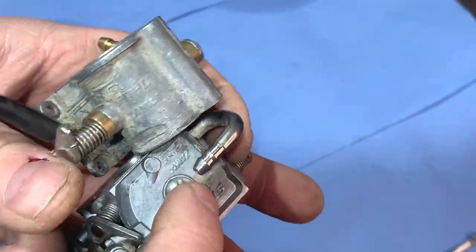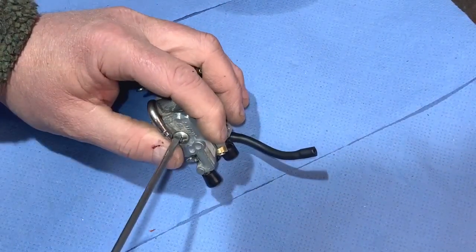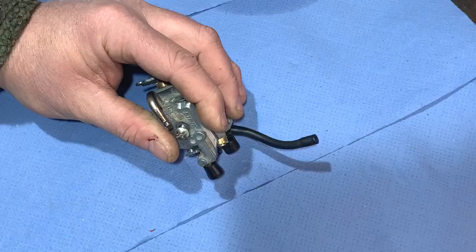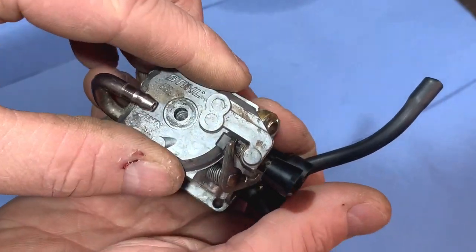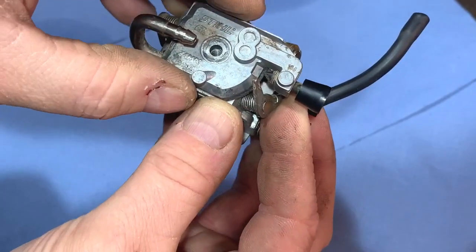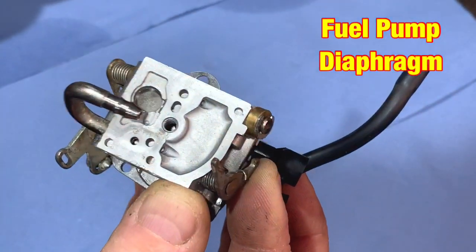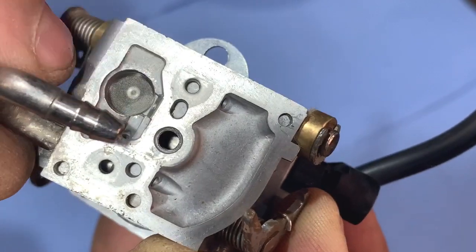I'll take these out as well, but firstly I'm going to take that side off. I'll put that around there and unscrew this. I had took this side off before because I wanted to check everything was right in the kit I bought. Just hold that throttle piece over a little bit to get that off. In there goes a gasket and then that screen piece — there's not too much cleaning needed on that side. There's a gauze there — looks very clean — so I'll probably leave that in.